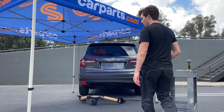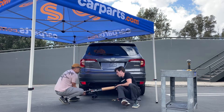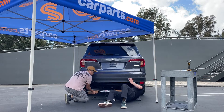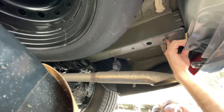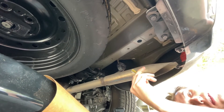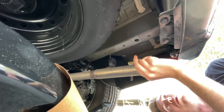When you're getting ready to install this hitch, you're going to want a friend to help you — this thing is pretty heavy. Go ahead and line it up under the car; there's going to be three bolts on each side. If the threads under the car look dirty, you're going to want to take a wire brush and clean those out, but this car is pretty new and there's no debris in there, so we can just go ahead and screw these in.